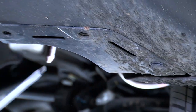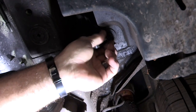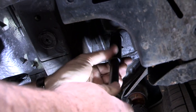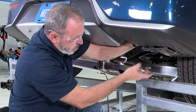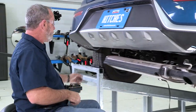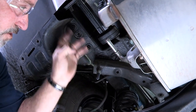It's just a plastic nut and you can probably get it with your hand. I'll take my socket and just spin it off — just using my hands here to loosen it down. Now that we have all the hardware that was holding the underbody paneling up removed, it's just pulling it down just like that. We'll set that aside and repeat the same step on the driver side. The only difference on the driver's side is that it has two nuts rather than one.